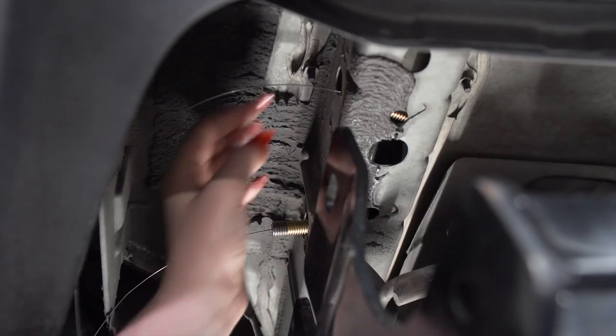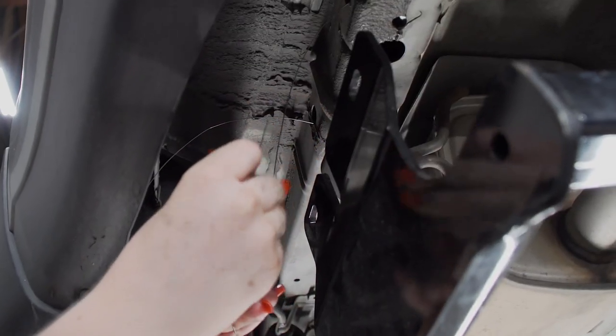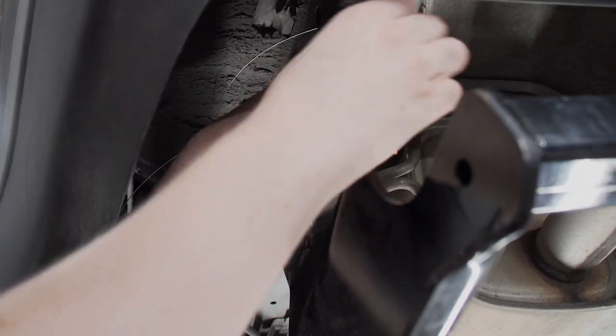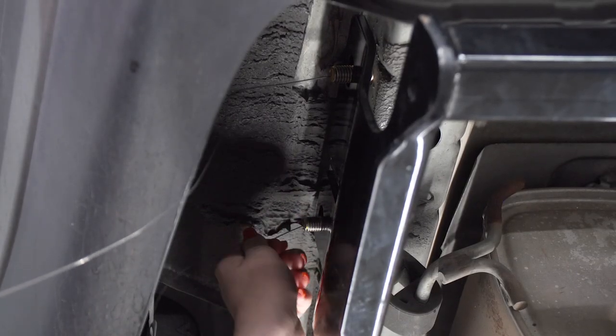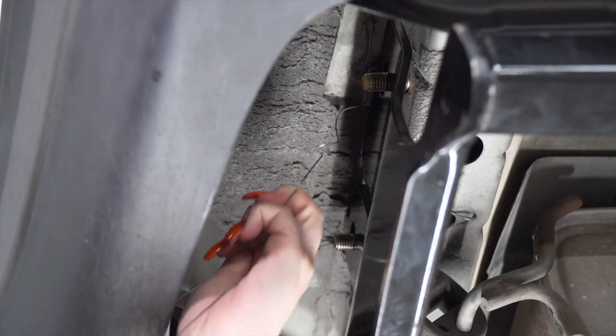On the driver's side, we're going to push the bolts back into the frame. We're going to take this flat washer, put it on the fish wire, and thread the fish wire through the holes on the hitch. Once we have the hitch lined up, we're going to pull our carriage bolts through the holes with the fish wire. The next step is to remove the fish wire.